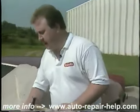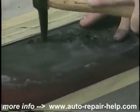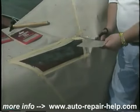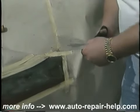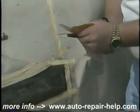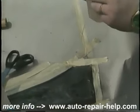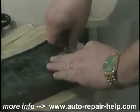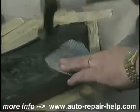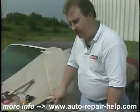What we want to do next is tap the rusted areas inward so that we can apply the body filler. We're going to cut out the self-adhesive metal patch to bridge over our rust out here. I just want to trim it so that it bridges over the inner edge of the metal where the hole begins. You want to countersink the metal patch slightly so that it will be below the surface. Any excessive metal patch can be sanded off during the sanding process.